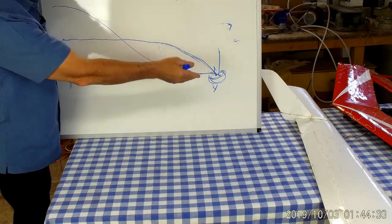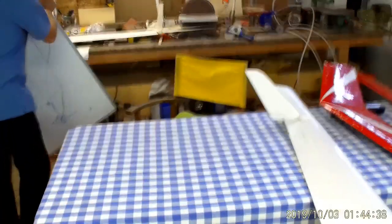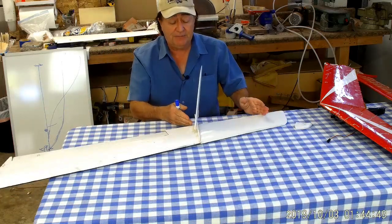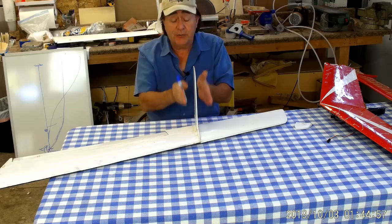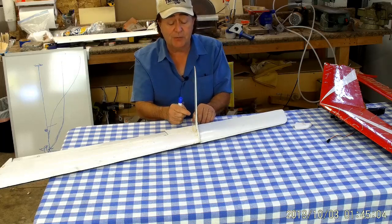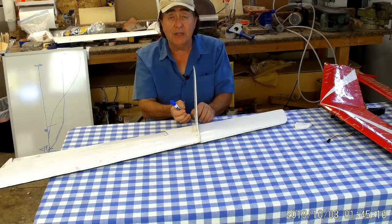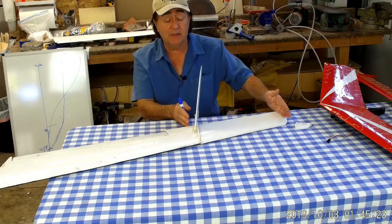There's no vortex there. You might want to put the winglet out there for control effectiveness, moment arm, yeah, I understand that. But if you're putting a winglet out there to stop the vortex, well, you're confused over what's actually happening. And that's a stupid place to put it. Now, because there are trailing edge vortices along any wing until you stop generating lift, I can put a winglet here and I can set it aft. And when I set that winglet aft, I'm placing it in the trailing edge vortex. And I'm stopping the vortex there, pulling the energy out of it, and it actually increases the performance of the wing. So you can place a winglet inboard and gain the true effectiveness of that winglet as both a fence and as some energy recovery out of the trailing edge vortices and stopping the vortices in this general region here. There's no vortices out here. This is a non-lifting surface out at the tip.